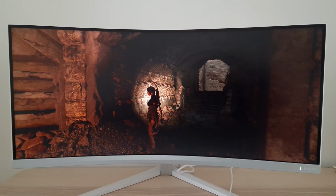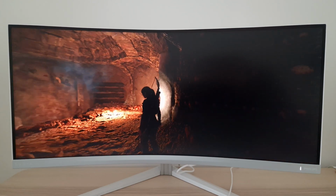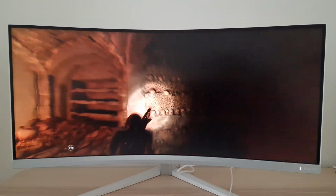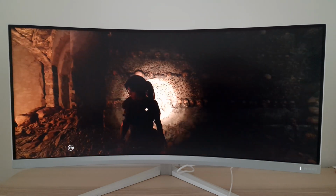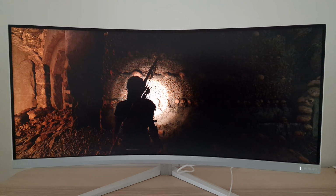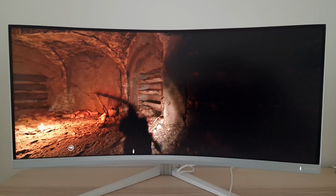I've brightened the room up a bit, turned the ambi-glow solution off. It's not exactly a bright room, it's what I describe as moderately bright, I suppose, and again, that takes the edge off the VA glow, and you could argue that the perceived contrast is improved, but actually you will see some glare on the screen, and that's diffused across the screen. There isn't a lot of direct light striking the screen surface. I've got quite a controlled lighting environment here, so this could be worse depending on your lighting environment.